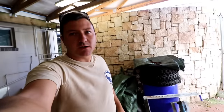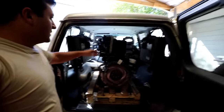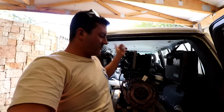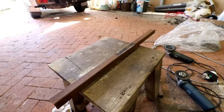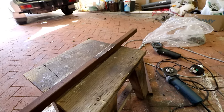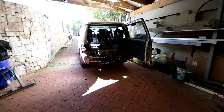We're into day three of the build. As you can see, the engine is still in the back of the Pajero. We're just getting some brackets fitted to lift the engine — they'll be temporary just so we can get the engine in and out of the car and onto the boat. We're building a spreader bar, just a piece of square tubing that only needs to hold 240 kilos, with chain attached to either end and a lifting lug in the middle so we can handle it from one point, with safety lines attached.